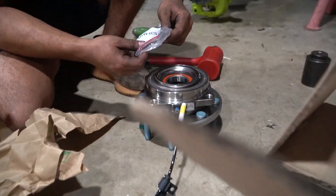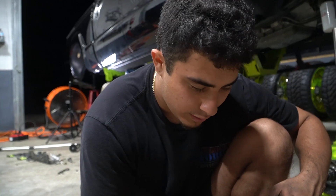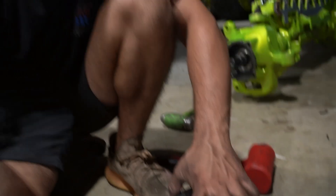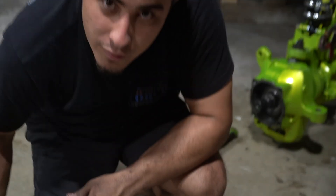We have OEM hubs for Cam's truck. The truck's a 2015 so they're probably original hubs, and we got them replaced with a set of OEM hubs from Ford. Why OEM over upgraded hubs when there are companies that sell upgraded versions? Every truck you guys see us build has OEM hubs on it — with 3-inch spacers, 26x16s, 37s, 40s. These trucks are going to be on 30x16s and 42s with OEM hubs. It's what's worked for me, I have no complaints, and they have a factory two-year warranty.